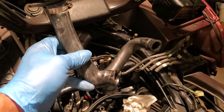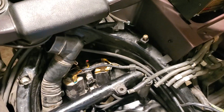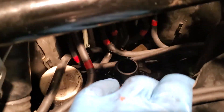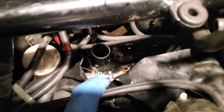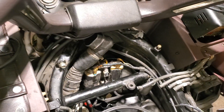This is the filler hose. As you can see, it's set like a Y. There are three clamps — two on top and one on the bottom. Just remove that and put it to the side. Underneath you will find the housing for the thermostat, right here, which has three bolts: one there, one on this side, and one in the back. Once you remove that housing, you will be able to get to the thermostat. There is definitely no way around it.